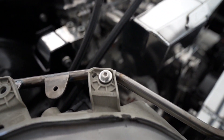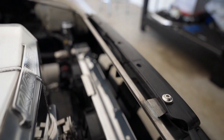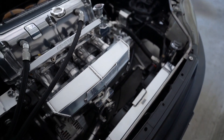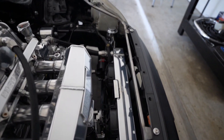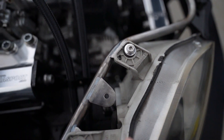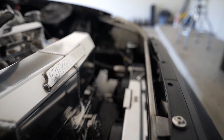Another reason I went with the tubular core support was to have all this extra space up front. It just gives me a lot more room for piping, intercooler, stuff like that — just opens up all that area. A couple of people DM'd me asking if they should go with the tubular core support. One thing to consider is that you're going to need to run hood pins or something like that because it removes the whole section where the OEM hood latch goes. Walter added these extra taps that allow you to run your hood pins right there, so it's all good to go right out of the box.